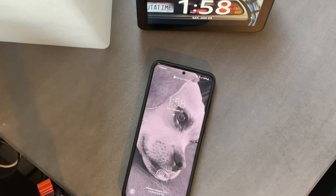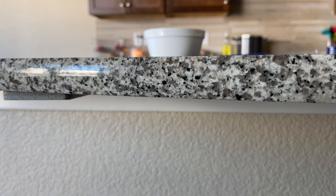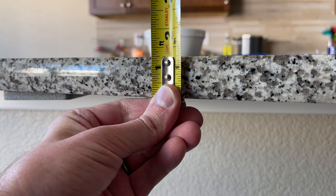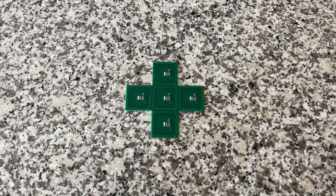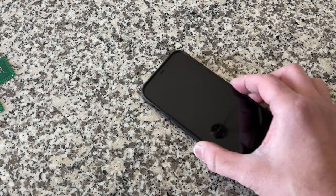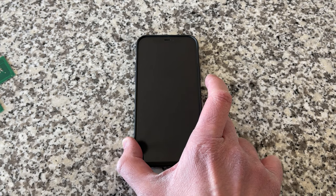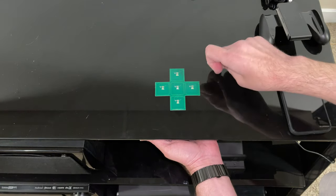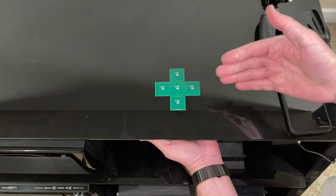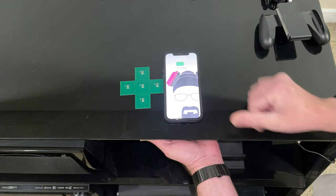This is probably the second most common place you're going to want to wirelessly charge your phone. I also wanted to test this out with my granite countertop. It's about one and one-quarter inches thick, which is a little more than what this charger is capable of charging through. It is powerful enough to light up the little LED tester, but when I try to charge my phone it just won't work — even without a case. If the granite were less than 1.18 inches thick it would definitely charge through it. And here is the top of my entertainment center — it's glass — and it does work through glass.